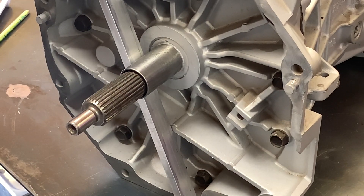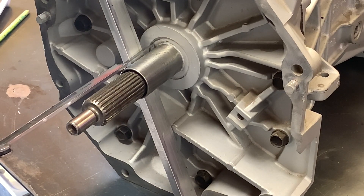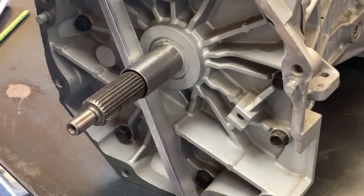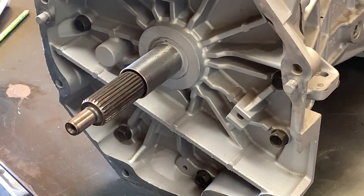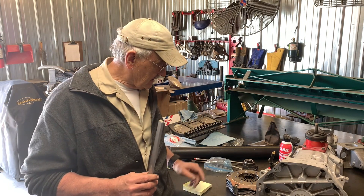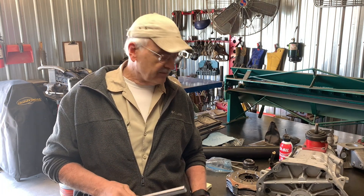We take the probe and put it in the center of the steel seal that the bearing is going to push against, then push it in — and we got 1.406. Now I'm going to take several measurements around this seal. When you're done, you use the smallest measurement because that's the one that will push the throw-out bearing furthest out. Our smallest was 1.391. We then subtract the thickness of the straight edge — 0.850 — and we came up with 0.541 inches: the distance between the mounting flange of the transmission and the bearing surface.